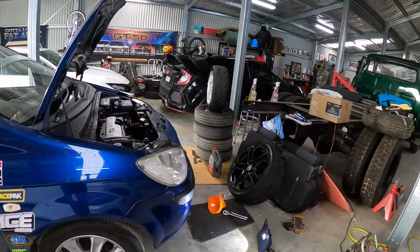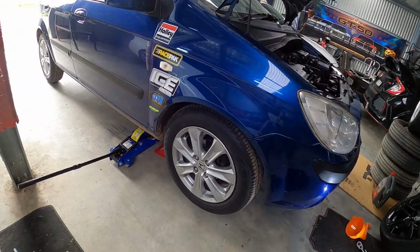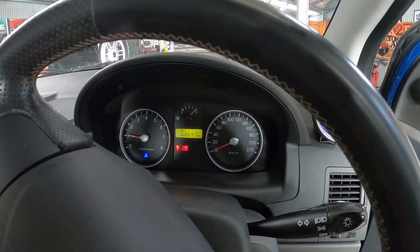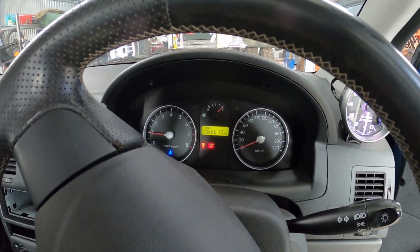Well, the final step that often gets neglected is to take the car off the jack stands, make sure it starts, check the oil again, and go for a test drive. All right, the final step, as I mentioned, before you go for the test drive is to make sure the car starts, because you've been taking spark plugs and stuff out. Make sure with your air filter you haven't triggered an engine light or a sensor. Let's go. Very nice. No warning lights. Sounds good. I think we're past the first test.